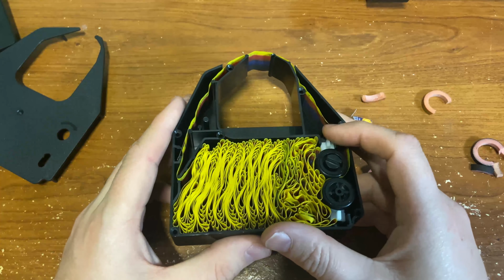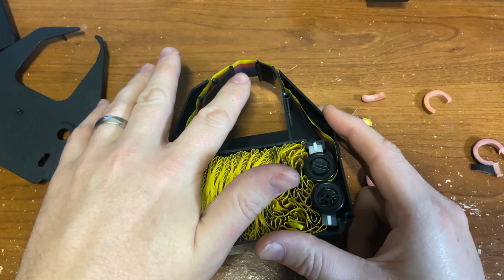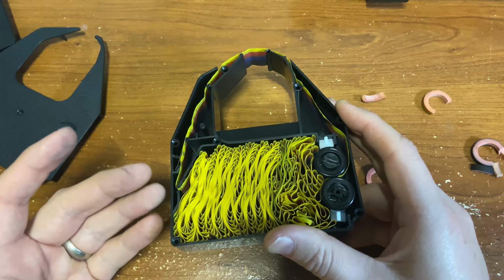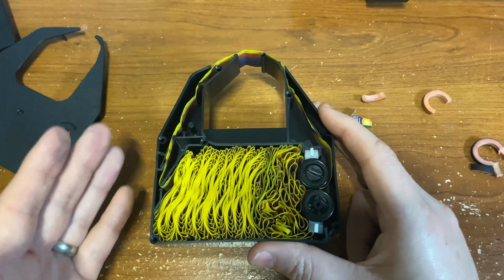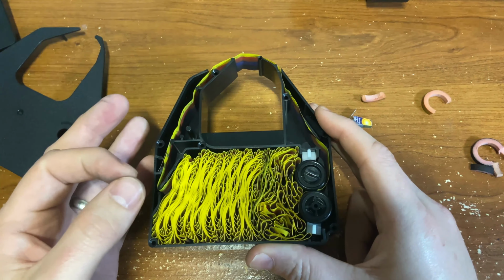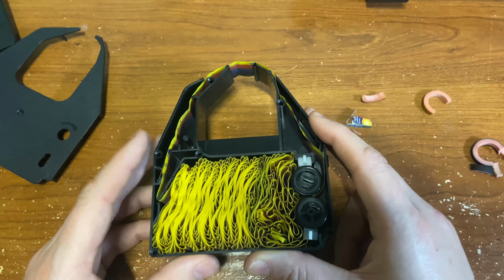I have found that if you were to get some fabric tape, right, you can get that at like a Joann's Fabric, a craft store. You can put that on the back of it. If you do have a rip, you can repair this in a very similar fashion that you would an 8-track, okay? I've had mixed results on that. They will eventually fail. If this ribbon starts getting holes in it because your rollers failed and you're getting all that pressure on there and it starts to fail, it's going to rip eventually. So you can buy yourself a little bit more time in putting some fabric tape on that.